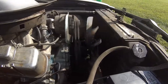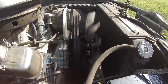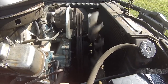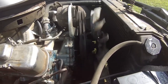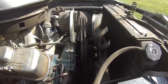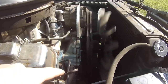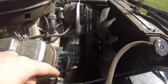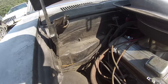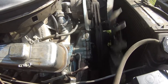As you can see, I need a new harmonic balancer, an AC pulley, and maybe another water pump pulley too. I'm not sure — we'll have to pull that harmonic balancer off, get a new one and see what else is wrong with it. We need a new AC pulley for it to run because it won't run without the pulley. As you can see, we don't even have an AC compressor, but we still need to pull it for the engine to run. It's more like a spacer is how it's being used.